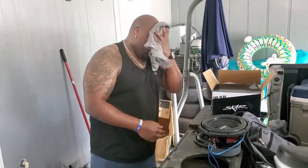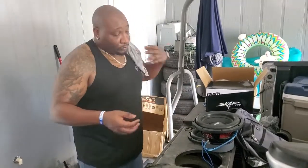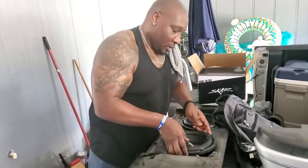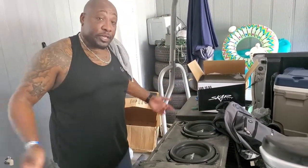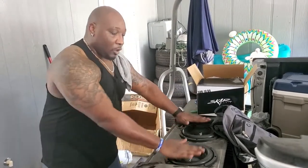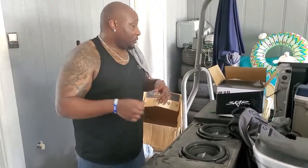I've already done the other subwoofer, so that's in, and now reading to the amp it should read one-ohm. Go ahead and throw these in here — they fit pretty good, make it sexy, that's cool. And that's effectively done. All I have to do now is run my screws to lock it down in place. I already checked to see that the excursion isn't going to hit the floor while it's firing, and it fits under the seat, so everything should be golden.